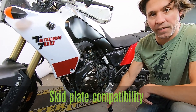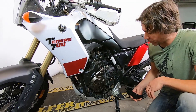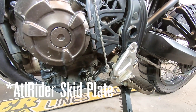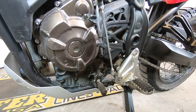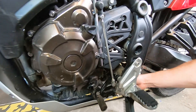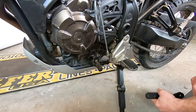We engage with the two M8 fasteners. I'll talk through this in case you've not purchased the Alt-Rider design but have another skid plate and are concerned about compatibility. It's fine if your skid plate utilizes these two M8 frame bolts. We use them because we feel the small tabs on the frame bar are not enough for a skid plate — we're capturing both M8 bolts, and the bracket captures that from behind. That's why the ratcheting spanner is nice for that final tightening of the nuts from behind.